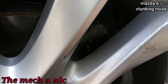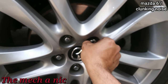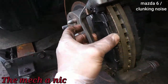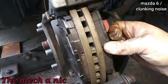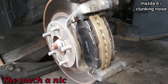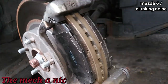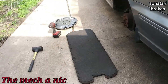There's so much grease packed everywhere around those brake pads. A few days later, the owner went to the dealer and got OEM pads just like I suggested. With the brand new dealer pad up front, there's absolutely no movement up and down. With the old pad you can even hear it rattle - with the dealer pad, absolutely nothing. Also, the pad is sitting much closer to the edge of the rotor, which will get rid of this rust line where the pad was not making contact. It's crazy the difference between aftermarket and OEM parts.